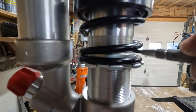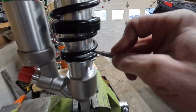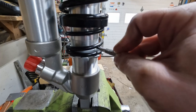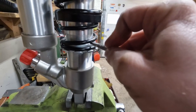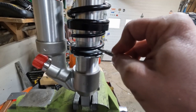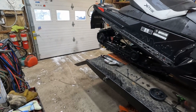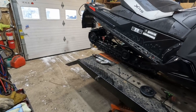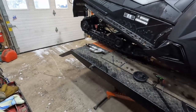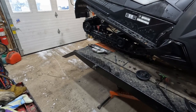Also, what I'll do — where the top of that other shock was ground flat, I'm assuming it was the track that helped — I'm going to check the track tension. I'll do that in a separate video probably, because there's a little bit of a procedure to it. It isn't difficult, you just have to hang some weights and measure. There are special tools, but I almost never use them because you can do it with a tape measure. If the track doesn't ratchet and the thing goes down the trail, what more do you need? I suppose what you need to do is not chew the top of the shock off. We'll install this and go out and ride it in a blizzard.